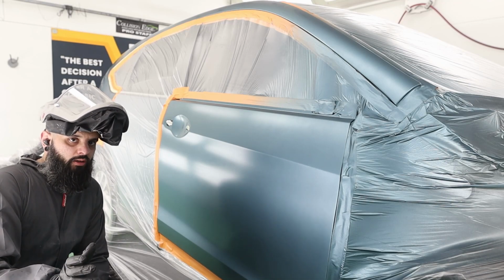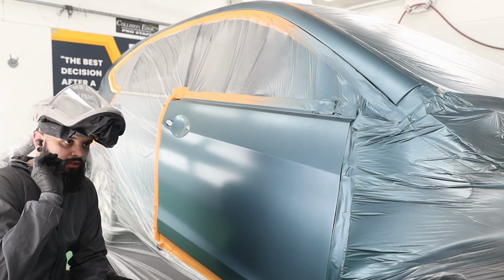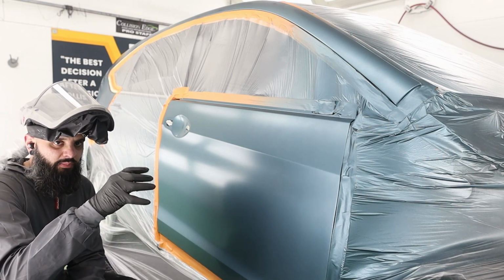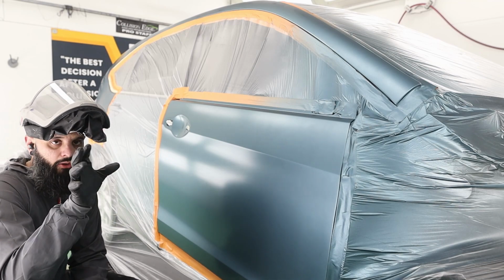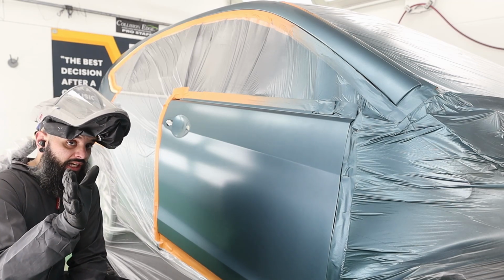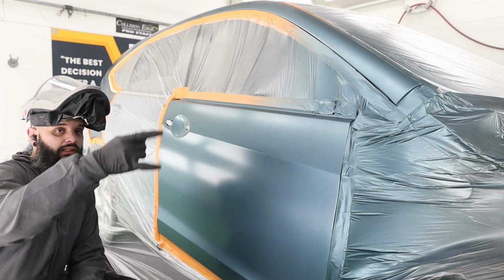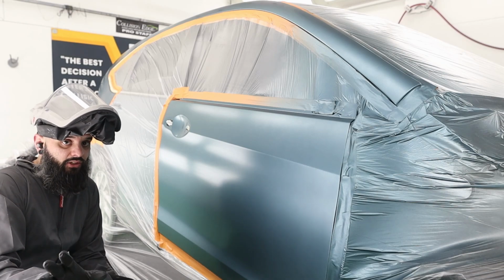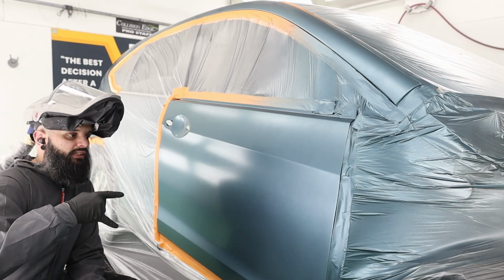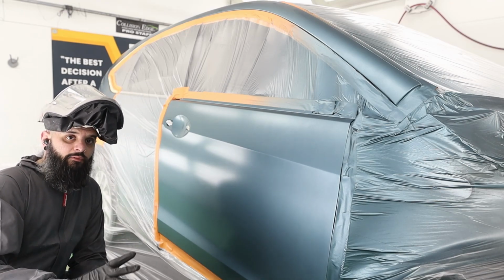If you're new to waterborne, your control coat will not fix everything, but if you have a little tiny bit of blotchiness, mottle, as some people call it, it'll smooth that out, as long as you take your time with your control coat. You can't come in here and just quickly control coat this and think that that's good enough. You need to back off the panel and slowly just set all your metallics, make your final blend, and then let that fully dehydrate.